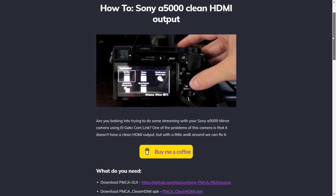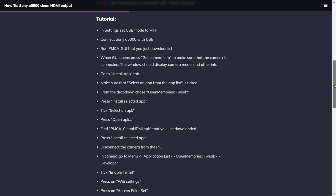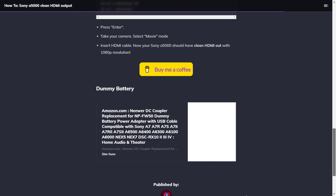As I mentioned at the beginning, there's one more thing you have to do once your Sony A5000 arrives — make it have clean HDMI out by following the tutorial linked in the description. This process involves downloading three files, installing two lightweight apps on your Windows or Mac computer, then installing an Android app on the camera — because the camera runs Android — and finally sending it three commands over a PuTTY terminal command line window. You can power it with the dummy battery and use a micro-USB cable to do all of this. It takes about 10 minutes. It was so easy that I actually bought Syrix a coffee for five British pounds, bringing my total to $227 — but that last expense is optional.